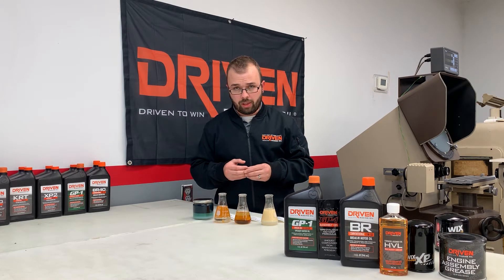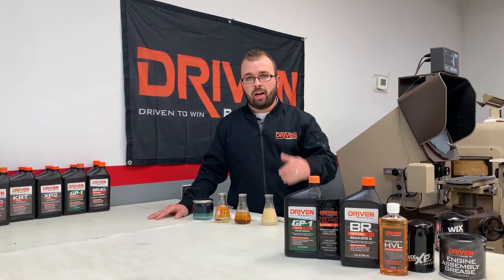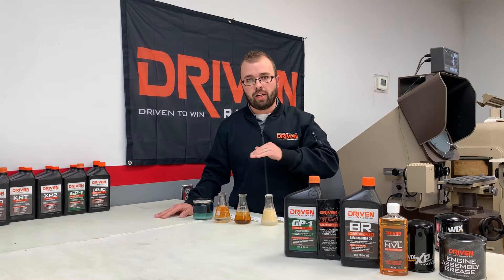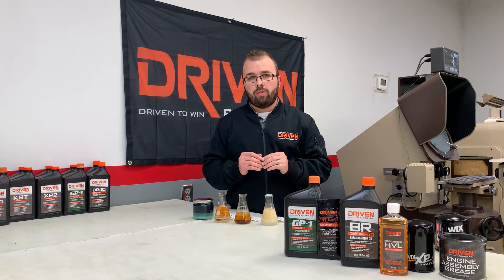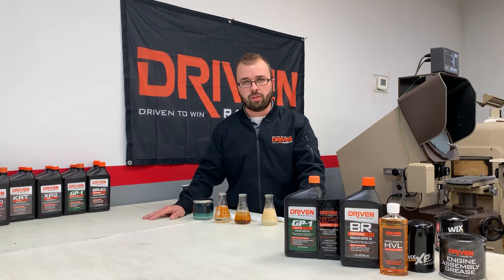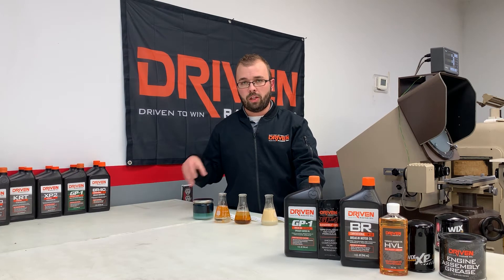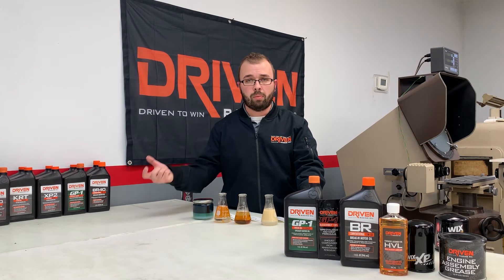The break-in oil chemistry is key. It's not the same as your off-the-shelf engine oil. The main points of a break-in oil chemistry are higher ZDDP or zinc, and lower detergent. The reason you want higher zinc is because there is no zinc phosphate layer on any of these parts already. So you're trying to lay down a primer, if you will, on the parts to create a good sacrificial phosphate film to help these parts mate and wear in together. The lower detergent is important too because you want a lower detergent so that it's not competing for the surface area of the parts — not competing with the ZDDP or the zinc.